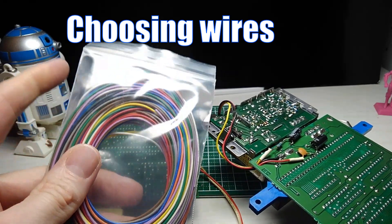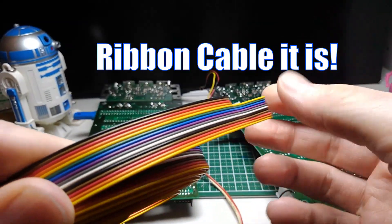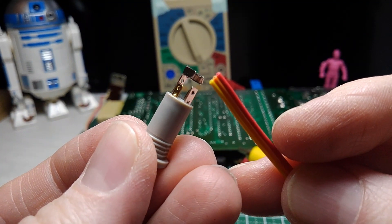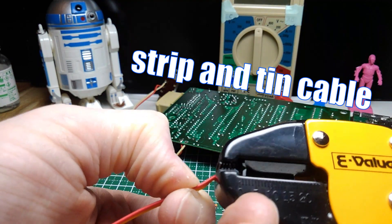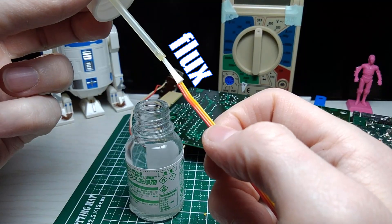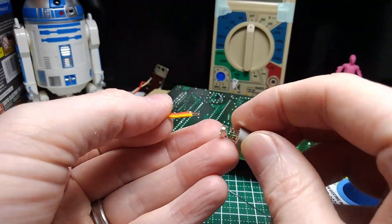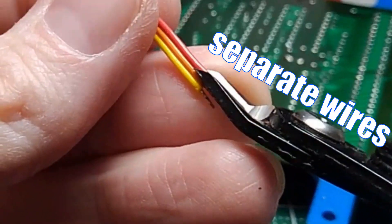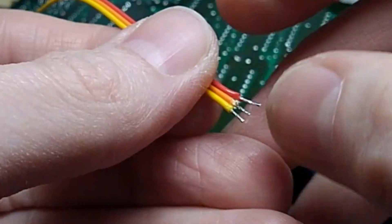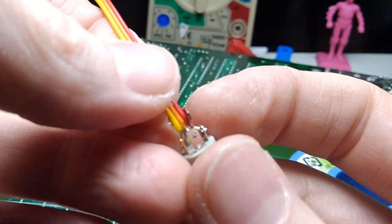You're going to need to choose your wires. Today we're going to go with a ribbon cable — it keeps the wires nice and close together, very short. Strip and tin your cable, and on the other end strip, flux, and tin also. It's good to separate the wires just a little bit so it fits better. You want to stick these into the little tiny holes on the TRRS jack, so you have to do a little bit of finagling with the wires, bending them out just slightly. You just have to have a little patience.